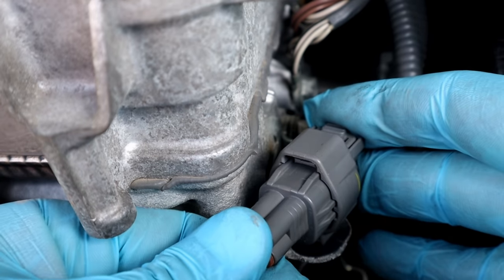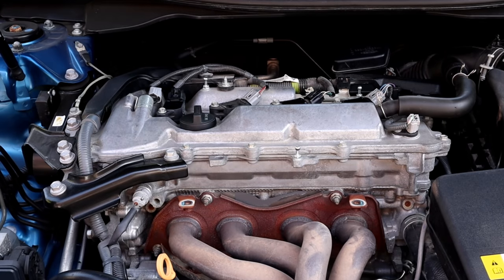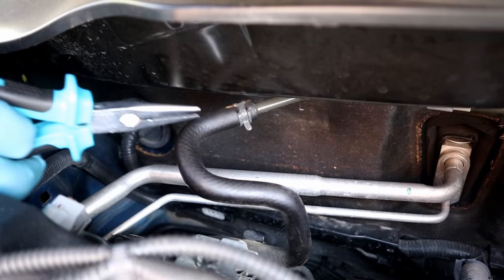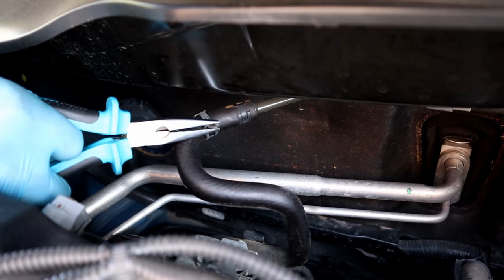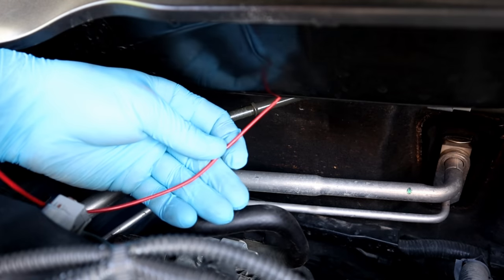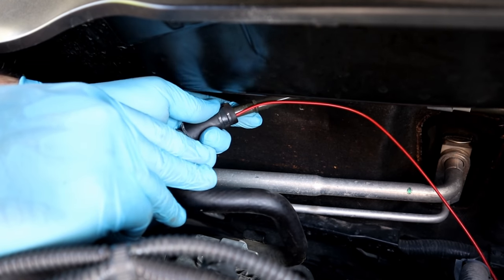For cleaning, I will be spraying carb cleaner from the vacuum line. It will also clean the intake valves as well. I have a video about that. Link will be in the description box below if you wanna check it out. Now remove the vacuum hose, put the cleaner straw in, and then put the hose back.